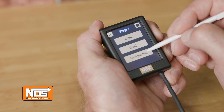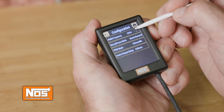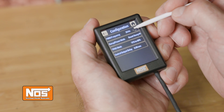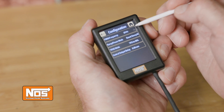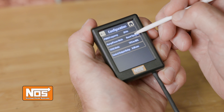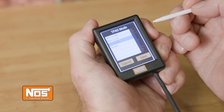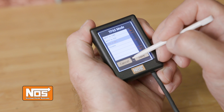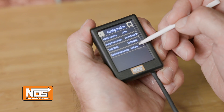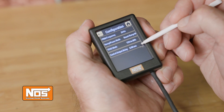The configuration menu allows you to adjust the following settings. The PWM frequency allows you to change the frequency at which the solenoids are driven. The ramp pause mode allows the controller to either reset or resume the progressive ramp that has been programmed. The throttle position activation switch mode changes the type of throttle input. Programmable 12V control outputs can trigger other functions such as ignition retards.